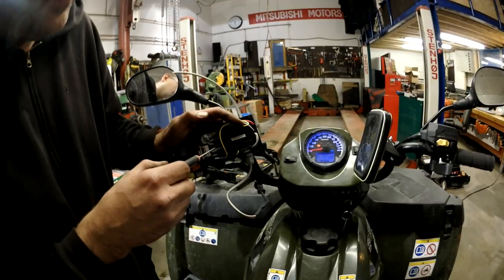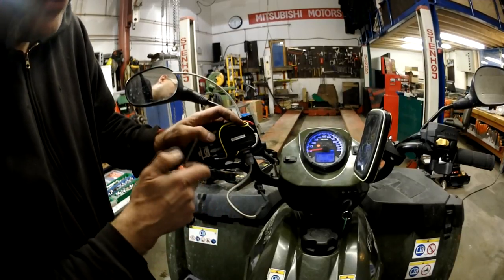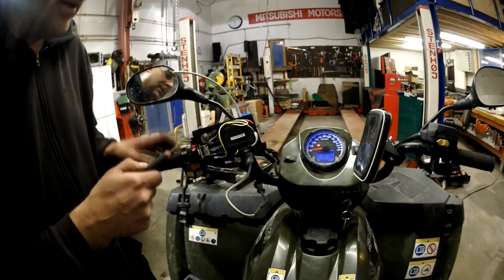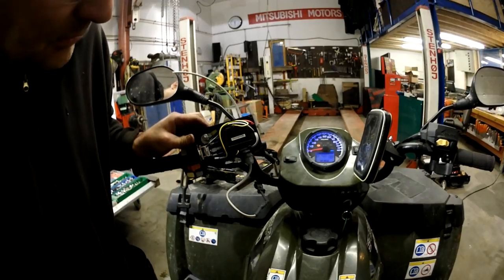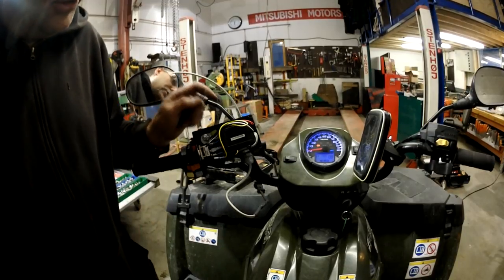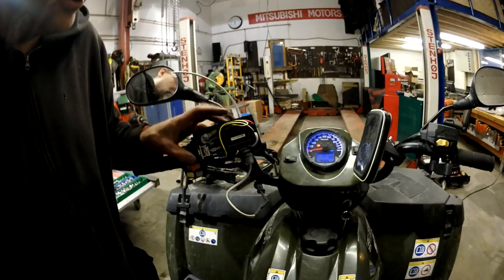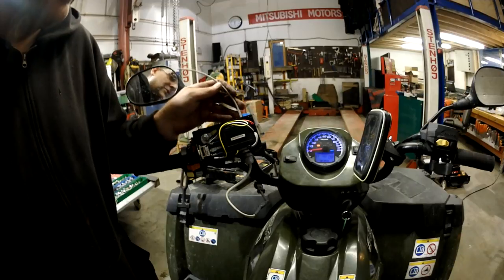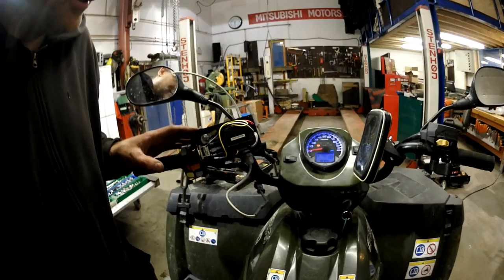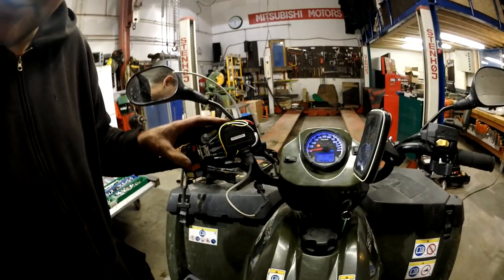And also the voltage to run this receiver is taken from this middle one. And then the negative is taken from the handlebar connection, from this stud bolt. So I'm gonna put the cover on, and I have ordered an aluminium casing from an internet web store, so I'm gonna change it over later, but just write these parts with this really cheap plastic housing that I had already in the storage. So now I'm gonna run with this.